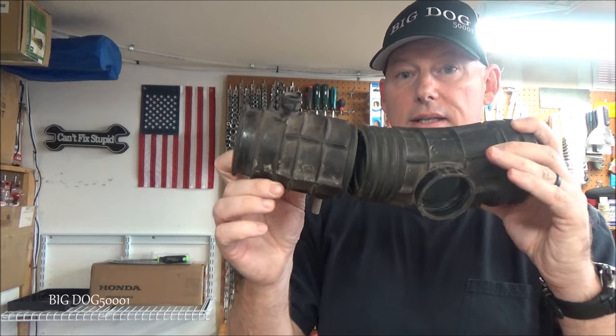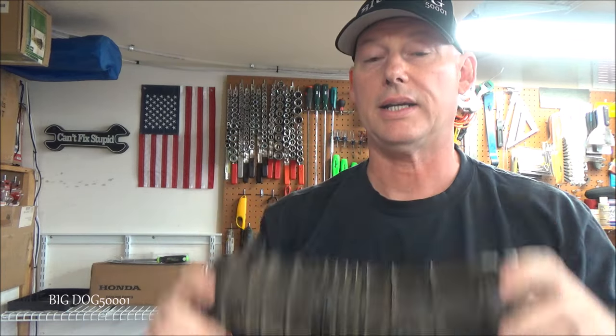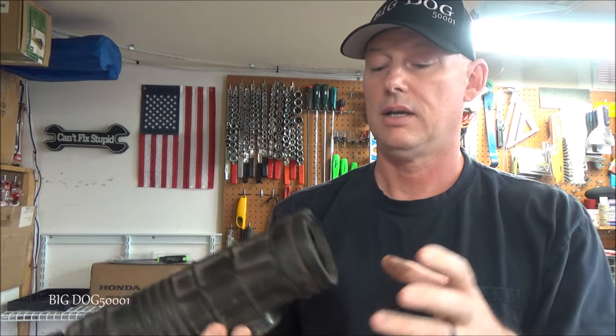However, in a case like this old Honda — if that's all it has and it doesn't have a mass airflow sensor — that can cause idle problems. When you're sitting there idling and all of a sudden your idle goes up and then drops back down, that's typically an indication of a vacuum leak. On especially those older Hondas, the engine computer didn't have a good strategy — there's too much air coming in and it can't figure out why, so it just dumps more fuel to get the proper air-fuel ratio. The idle rises until it gets too high, then the engine computer has a safety shut-off — it cuts the fuel injectors, the idle comes back down, gets normalized, turns the injectors back on, and then it'll do it again — up and down, up and down.